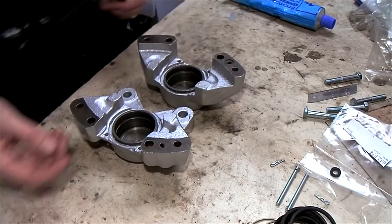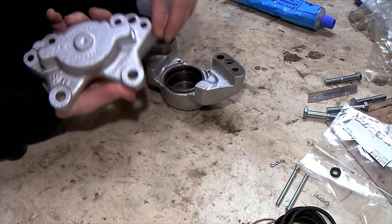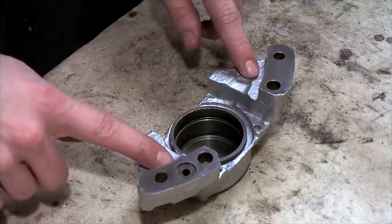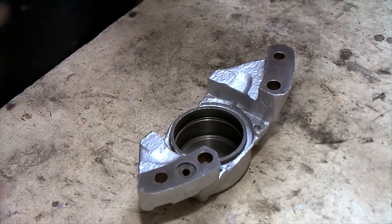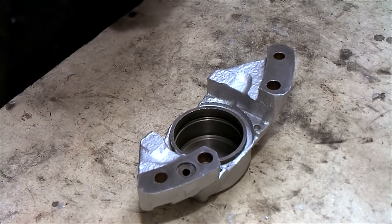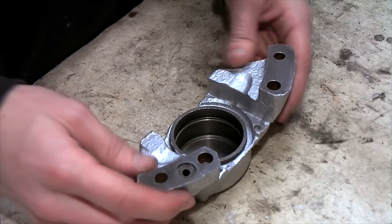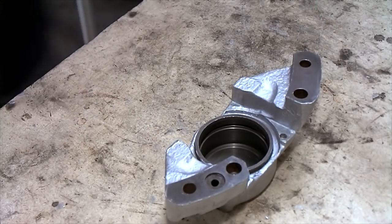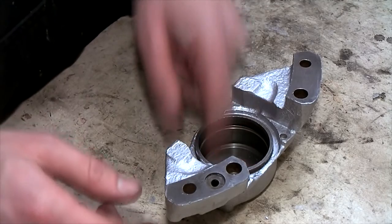I have managed to clean them up quite a bit. The bubbles have stayed away and I have removed the excess paint by drilling out all of the holes and tapping all of the threads again, and they look pretty okay. I am only going to show you how to do one half of the caliper — the other half is just the same — then we will mount these together. I had quite a lot of problems with the first caliper that I did and I will explain what those problems were when I get to that point. I polished the bores with a brass wire brush on a Dremel on a low speed, and the bores look quite nice.